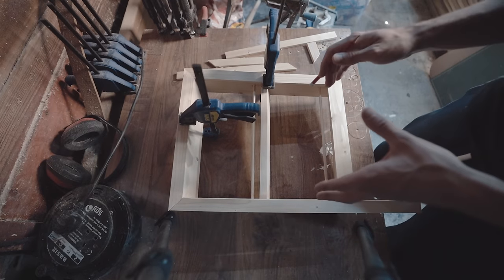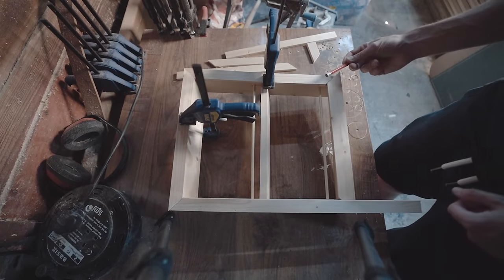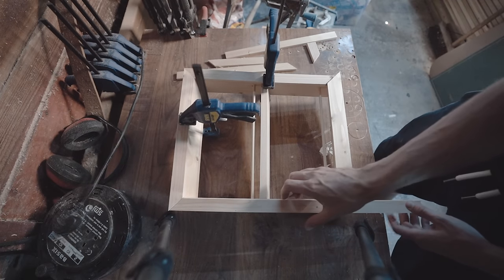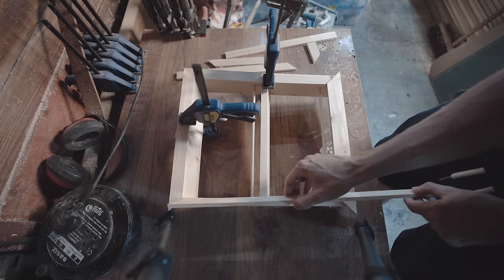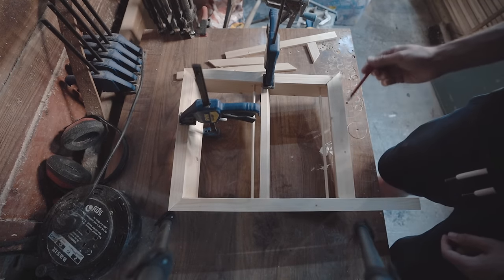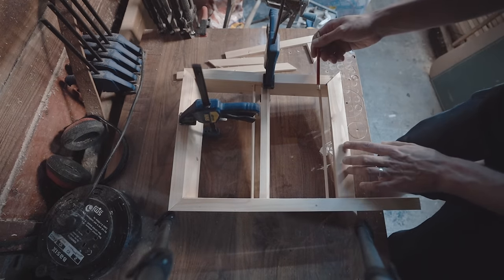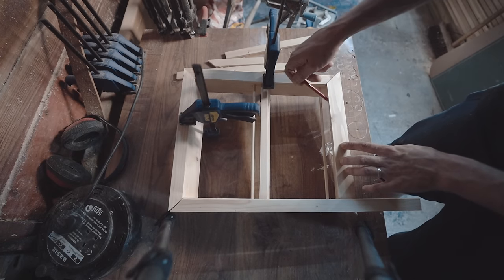This is going to be our little shelf unit that's going to go in that little recessed area in the side of the camper. And as you can see, I'm just cutting all of these 45 degree angles on the face frame itself, and we're leaving a little bit of an overlap, just under a centimeter, to allow us to fix it onto the sidewall. And you can probably see that this side here is actually a fair bit wider than these three. The reason being is that we're going to adhere the LED tape light under here, and then that should be out of sight.